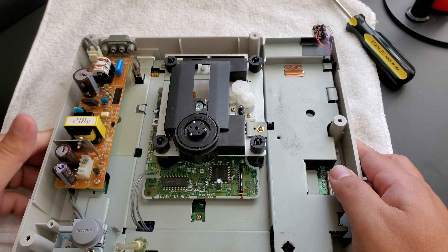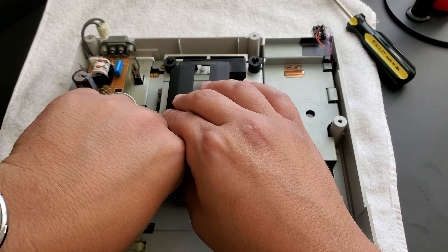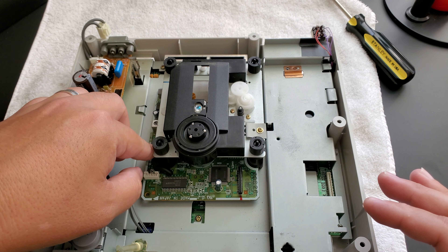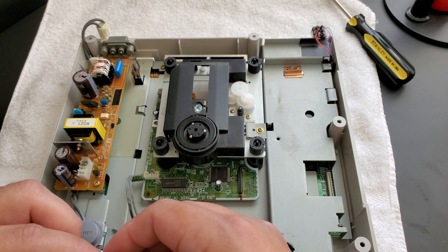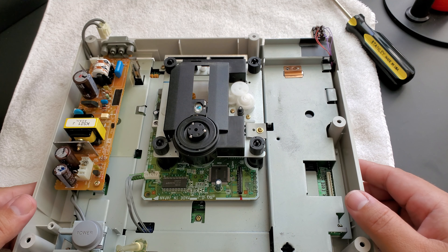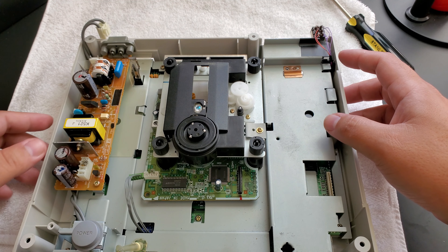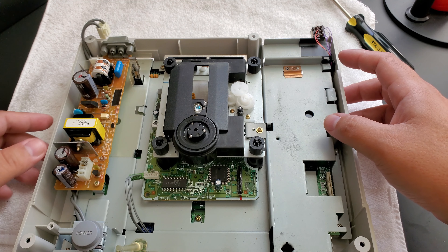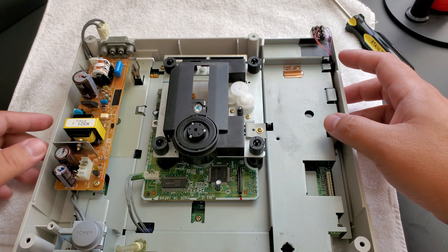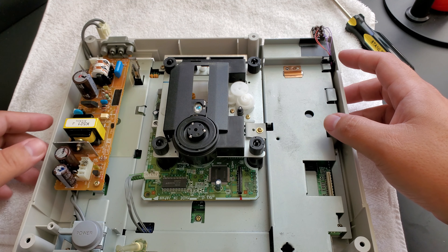The next thing we're going to have to do is remove the CD drive unit. We also need to make note of what type of power cable that we have — this is a five-pin power cable signifying it's a 21-pin unit. 21 pins correspond to the number of pins in the data cable from the motherboard over to the CD drive. So we are going to disconnect all power leads and all ribbon cables. This is a rubber coating that's just disintegrated over time — it goes right underneath the CD drive tray, but that's okay because we're not going to use this anymore. The MODE is going to totally supplement that.